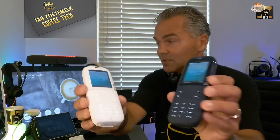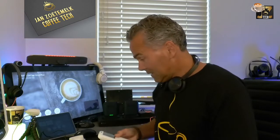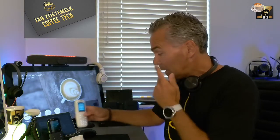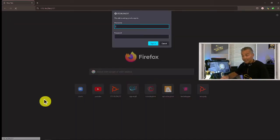We now have two phones registered. They will show 'no SIP registration' because these devices are connected to the base station but I haven't configured anything in the base station yet. I'll put both phones in the charging cradles. To connect to the base station web interface, read the IP address from the handset by going to Info on the phone menu, note the IP address, and then we'll go into the PC and show you how to upgrade those devices. The repeater will also be upgraded at the same time.